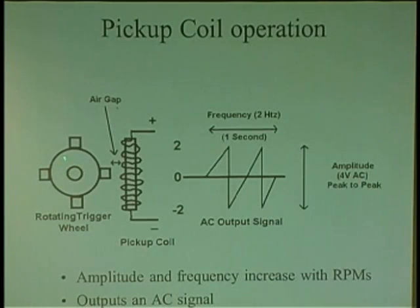And here's what you have to understand. You have a shaft which has a unique design in whatever is attached to the shaft, and it passes a magnetic core that they wrap a field coil around. So what affects the output of the AC voltage coming out of these two ends is going to be the resistance of the coil, which you can always measure. Back in the old days, pickup coils should measure, I don't know, 700, 1200 ohms. We used to measure them out. Just make sure they're not deteriorated, because you can have a weak AC output.